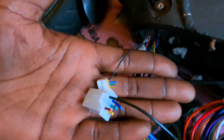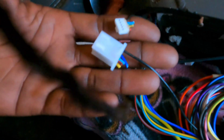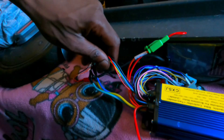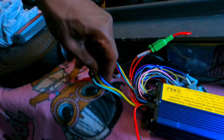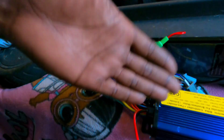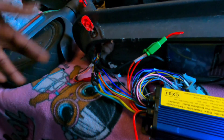I always leave my power cables till last. Don't power the vehicle if you're messing with the wires — power cables till last, phase wires and hub motor wires first. Let's keep things safe out here — dodgy but safe. Connecting our five hall sensor wires and our three phase wires, we basically have our motor connected to the controller — the brains connected to the muscle.